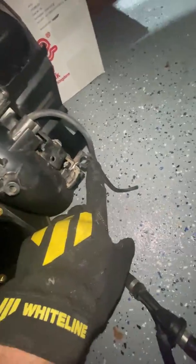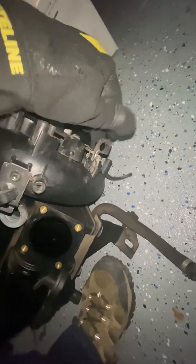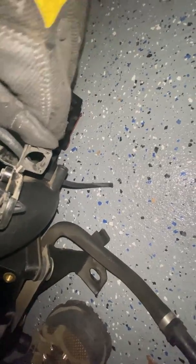Quick little update — you do not have to actually disconnect your fuel rail. At least on my intake manifold, you do not. Yes, I have a broken vacuum hose — it's been like that for a while. Here is where your fuel rail actually connects — this tab just snaps on and off, just like that. I use a screwdriver because I just like using tools rather than my hands. And that's all you need to do to get the fuel rail off. Unclip it, and then snake this thing through the last slot and you are good to go.